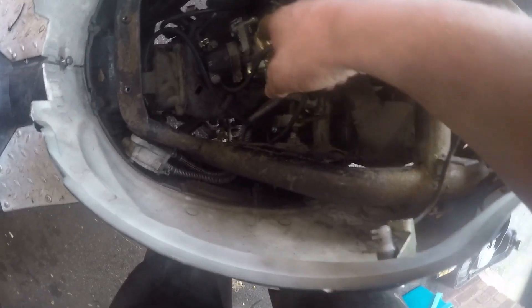What a ball ache - she got going pretty easy but then I took it for a little ride and it was playing up, breaking up a lot, running very lean. I put another carburettor on it and it was running so rich it'd barely start. I think it's all because of the exhaust - these GY6 engines don't seem to like running with no back pressure. What I've actually done is chucked on this carburettor which is actually for a 200cc GY6 quad.